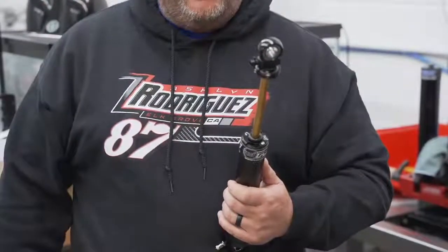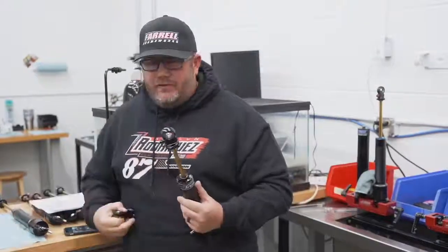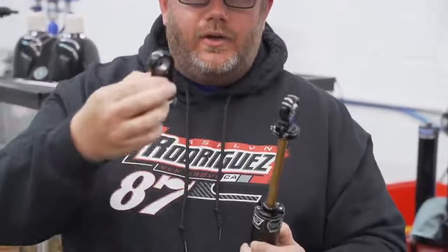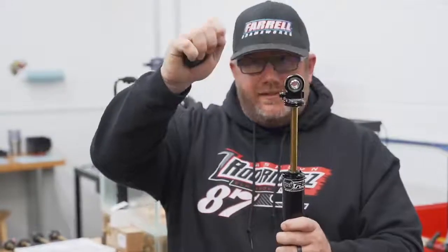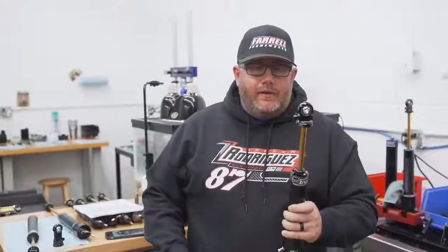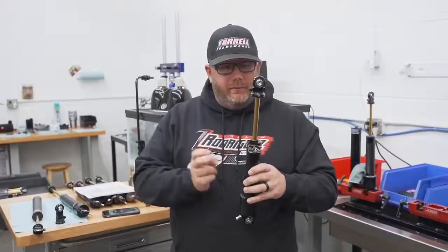The right front, most of the time, right in the center is about right. If you have a 7-inch shock, three and a half inches of shaft showing — three and a half compression, three and a half extension. If you need more extension, you can always go to a one-inch extended rod end. Also keep in mind: if you go from a 6-inch shock to a 5-inch, that's actually a two-inch shorter shock — the body is one inch shorter and the shaft is one inch shorter, so you're two inches less extension just to get one inch more compression.